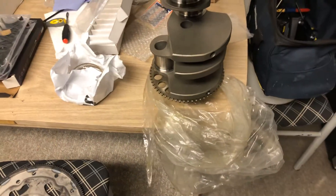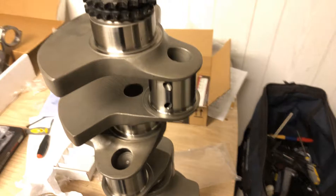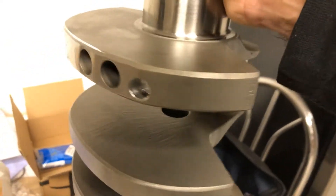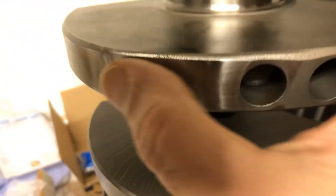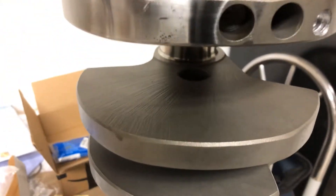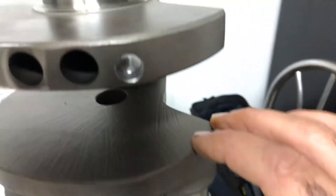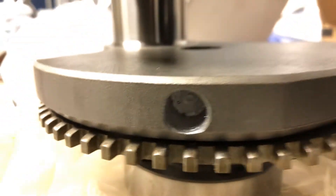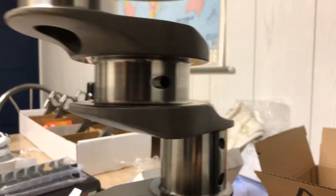I'm not going to put 25 pounds of boost in my engine. Here's my forged steel four-inch stroke crankshaft which was also balanced. You can see over here they took a little bit of material off. It actually looks like they filed this down a bit. What they did here is they actually added heavy metal - they plugged the hole, then took a little bit off on this side. Now my crank's all dirty with filings all over it.